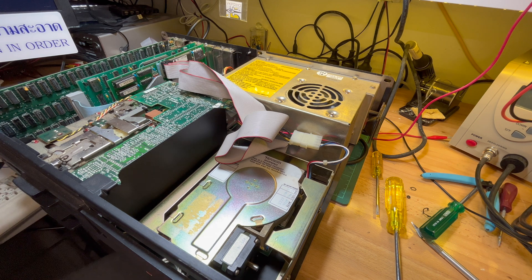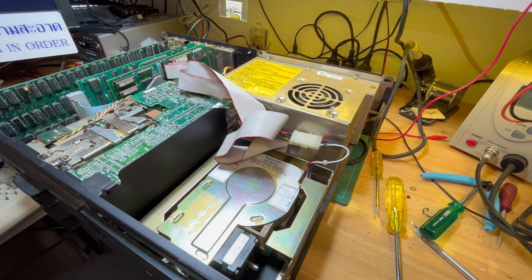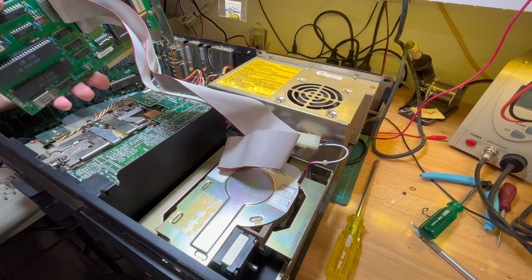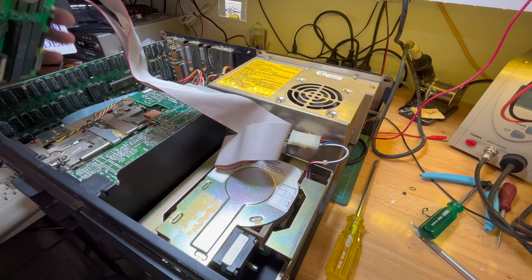I'm not getting any beeps or anything like that, so I don't think it's booting at all. A POST card would be good actually - you can buy those, might be useful. I've already got the memory expansion and serial/parallel card out - that needs fixing. I'll power off and disconnect the floppy controller, re-seat the CGA card as well, and try one more time tonight with the floppy and hard drive controllers out just to see if I get something on the screen. Still not getting anything at all.